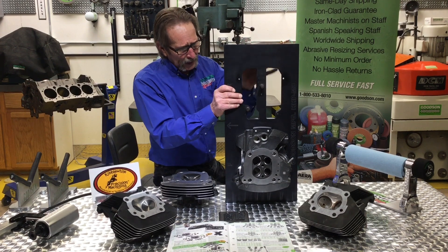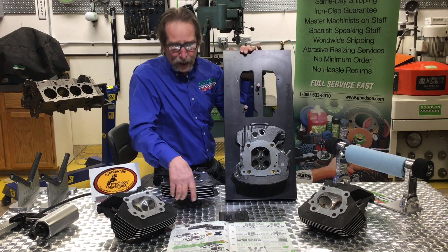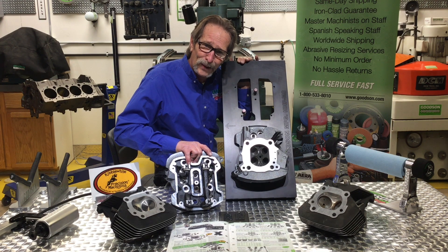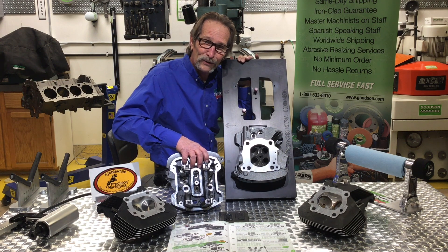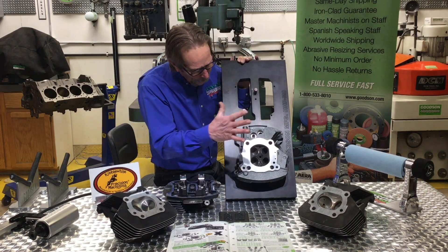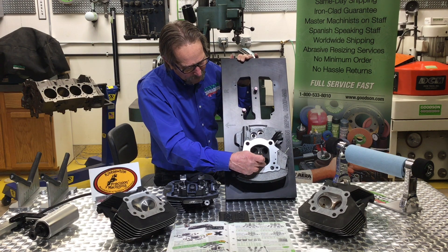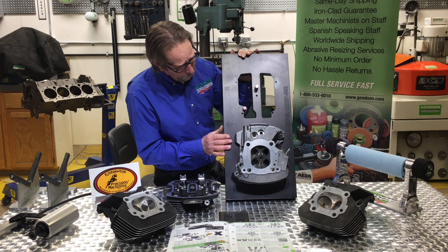It is doweled so that we can line up the exhaust and the intake valves. And by the way, just in case you're wondering, the M8 head is not an overhead cam — contrary to popular belief. The M8 head has rocker arms and push rods just like other V-twin applications. But getting back to the plate itself, we line it up on these dowel pins. This is critical because we've got our front head and our rear head, and we perfectly line up on the guide center line on the exhaust or the intake. It's really quite simple to mount.